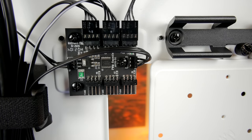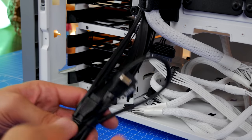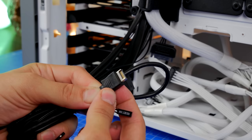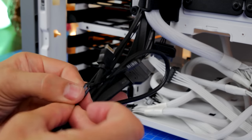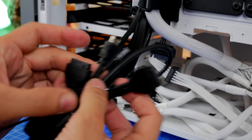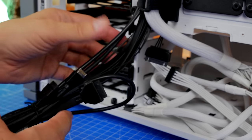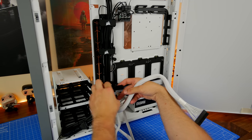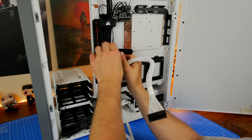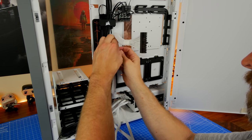Here's a close-up of the PWM controller — as standard it has the three fans plugged into it, and you just need to plug your SATA power connection into the PSU. The other connection goes to a system fan header on your motherboard. At the bottom you have all the front panel connections: USB-C, standard USB, power and reset button switches. There are two USB connections for the front panel because there are so many front panel connections on this case, so make sure your motherboard can support that.